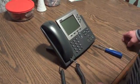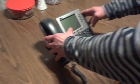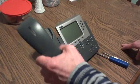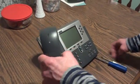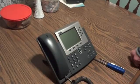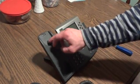Alright, I only want to do this in one take. These phones — the 7960 phone — has four notorious problems, and they're all related to one thing. Your phone rings, you pick it up, it keeps ringing. B, you pick it up, it goes to speakerphone. C, you're in the middle of something, talking to someone, and it suddenly disconnects. Anyways, they're all related to this stupid hook switch thing.